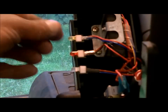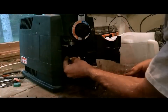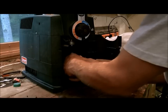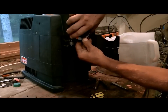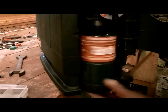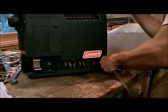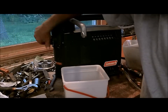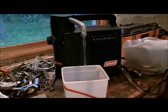When you're putting it back together, you've got your three lights. These things don't clip in — they just sit there. So save yourself some frustration and make sure they're in the spot before you put this back together. Once you've got that all put back together, put your gas cylinder back in. Then go ahead and plug your water back in and your electrical unit. After that, grab yourself a pail, turn it on and give it a try. Starts burning, kept burning — instant hot water. Thanks a lot for watching the Joe and Zach Survival Channel.